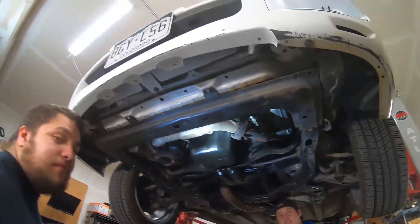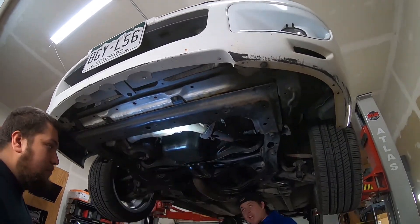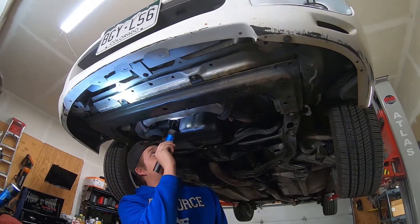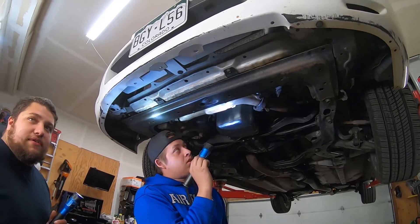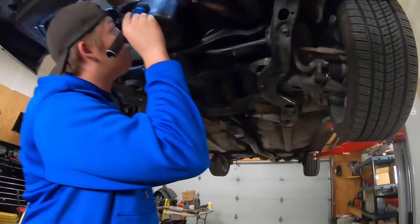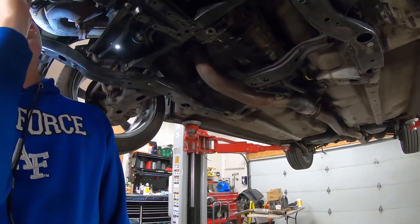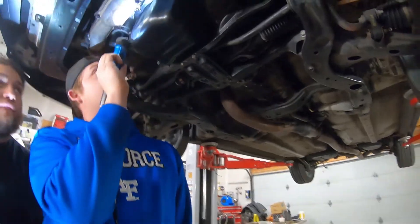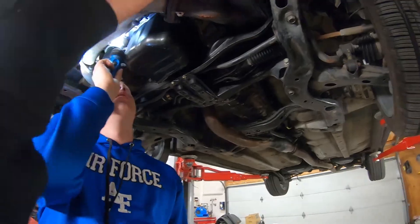And then for the oil pump, you think it's Fuji bond part and the actual front seal? Yeah, because it's leaking. You'll find it once you pop that front cover — you'll see if it's the front seal. If it's not leaking from the front seal, I won't even touch it. It's leaking Fuji at the back — you can see the Fuji is kind of broken up and it's not really a solid line. But the front one, if it was mainly just the front, you would just see it pouring out of the cover.